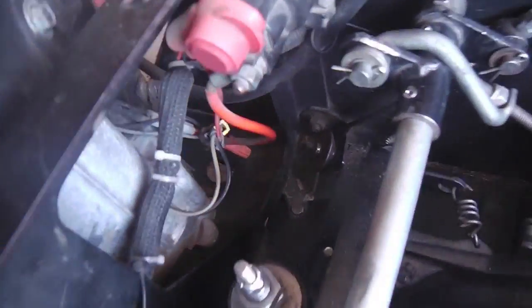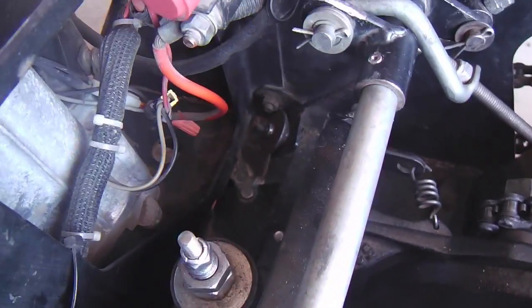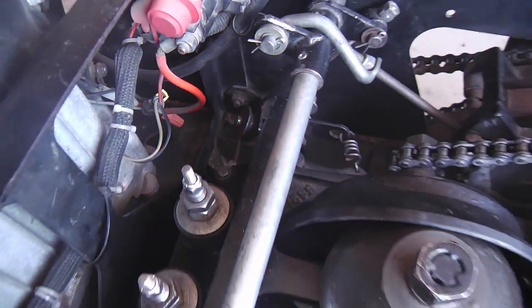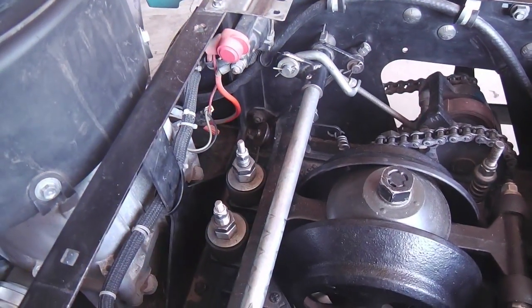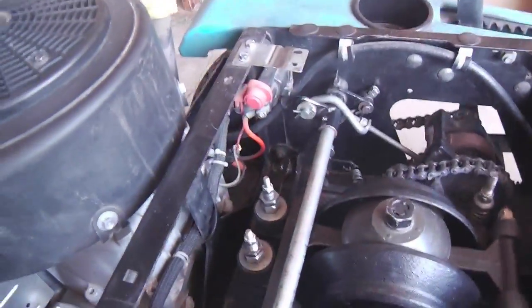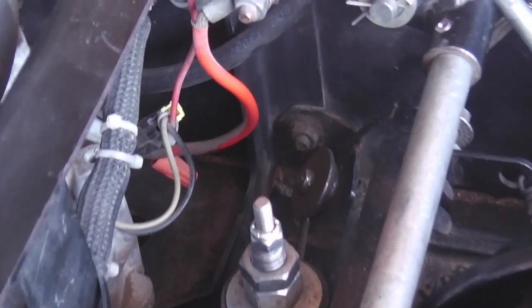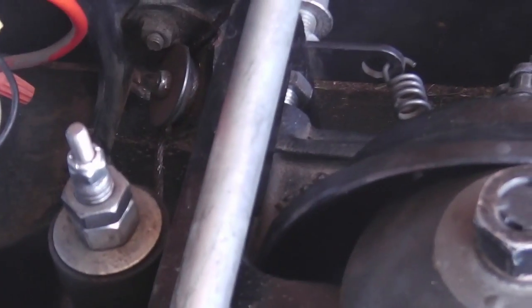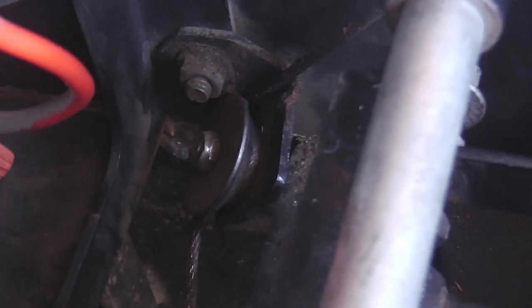Otherwise, you'll notice down in the corner there is that idler for the drive. Now that idler pulley, while the parking brake is engaged, removes the tension on the drive belt. And let me see if I can zoom. And as you disengage it, it allows that. But one point on that, there's a little pulley looking thing there. I replaced that cable there because it started fraying, and you can see I've got it lubed up pretty good now.